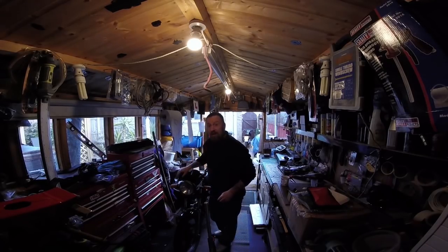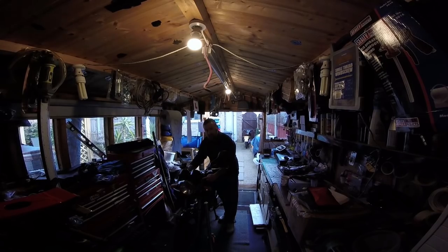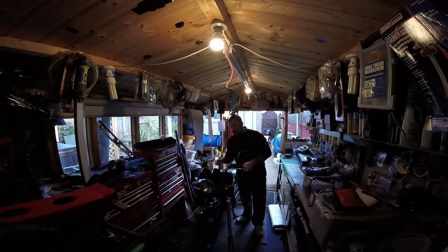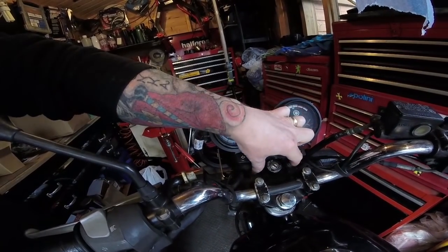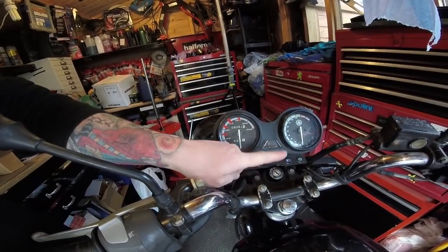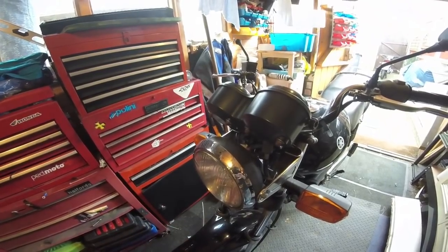All right? What's involved? Headlight has to come off. That's so you can get the wires. Clocks, undo, move forward. Two 10mm bolts here. There. There. And undo the main nut here. There. So, undo, undo, undo. Take these two out, lift that off. This will wiggle up and then you'll be able to get to the lock. It's as simple as that. The wiring feeds into the back of the loom of the headlight. So, headlight off, find the wires.